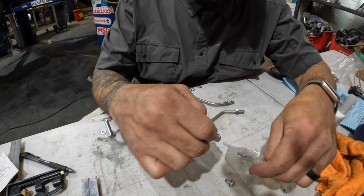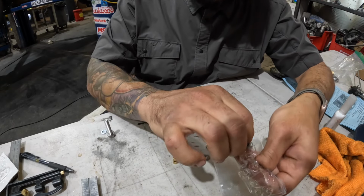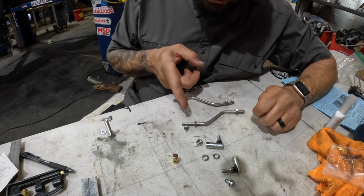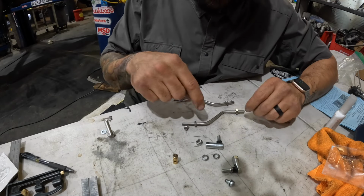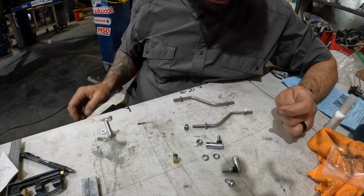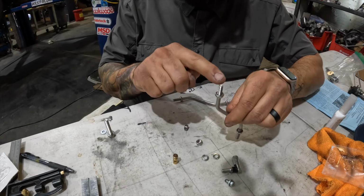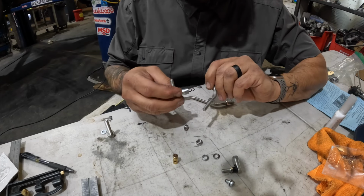So just from experience, I've installed a ton of Berg linkages. There is a possibility, because there are so many manifolds on the market, and I did order this for the tall manifolds, and these look like they may work without any modifications, but sometimes you may need to shorten the shaft, like you may need to cut it here. Even on some of the other ones I order for the IDAs, I actually have to tap that deeper and cut them so much shorter. So potentially I'm ordering the wrong part there. To bench set it up, the short side I leave on what's going to be my upper bar, and the long threaded side is going to be my lower, because if I need to do any cutting, I'll do it on the lower. It's easier to access.